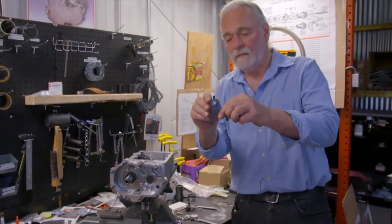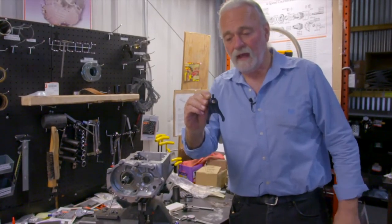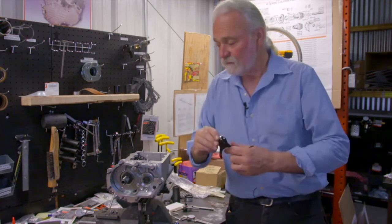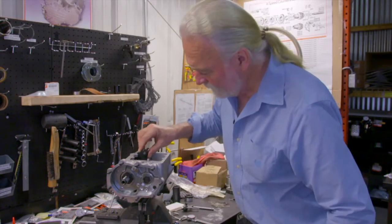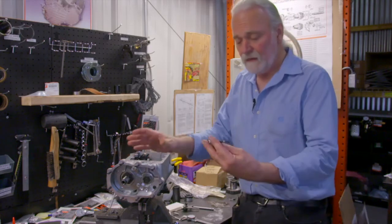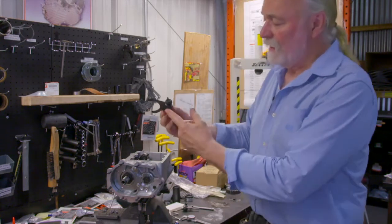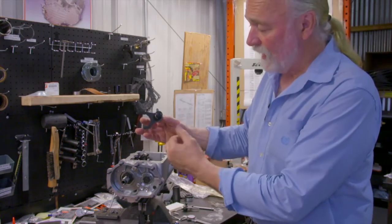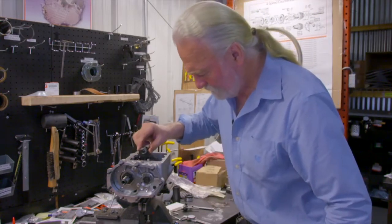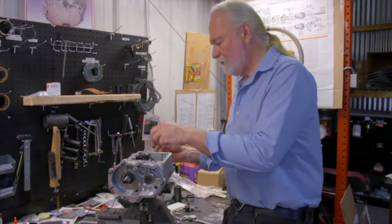As you can see here, at 12 o'clock, this is being kicked back roughly at about a 7 o'clock position as you're facing me here, clockwise. That way, you can come right in for a proper throw on the main shaft. Again, the counter shaft is about horizontal. Its large web or graduation is down towards 6 o'clock. You'll come in on the counter shaft shifter dog. We're now ready to run our shaft right through.